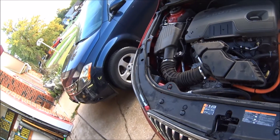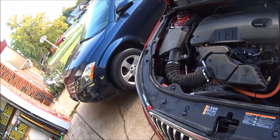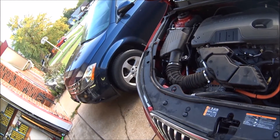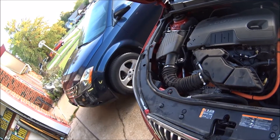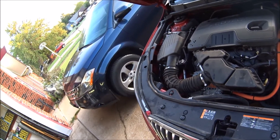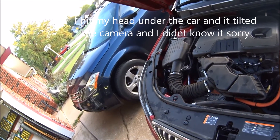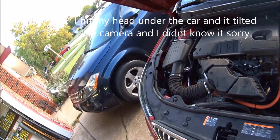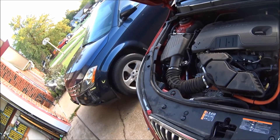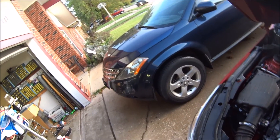If you're doing any maintenance: 15mm oil drain plug, oil filter is one and a quarter inch, I use fully synthetic 5W-30, and it does hold just a little over 5 quarts. I haven't drilled that in yet, but that's the oil filter I use. There you go.